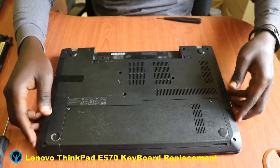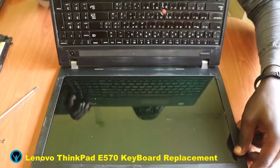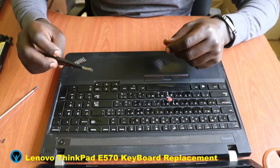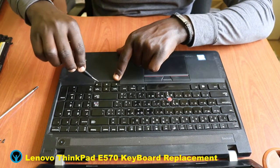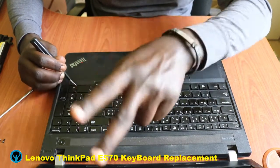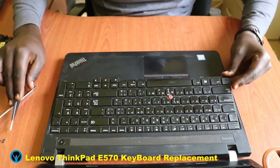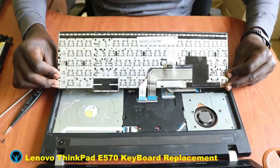Sorry — we need to focus on opening the laptop. Open it up, and here it is. So once it's open, we get our pressure tool — this minus tool or any tool that can enter here — to enable us to pry up the keyboard. We start by pushing it from this angle, pushing it forward, and just keep pushing it until it's loosened. Once it's loosened, we can just lift it up slightly and then pull it out gently.